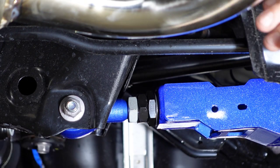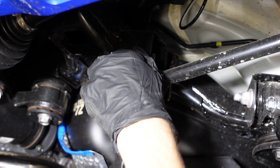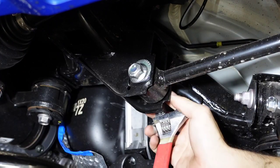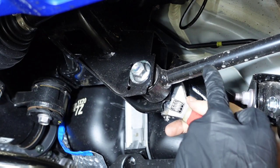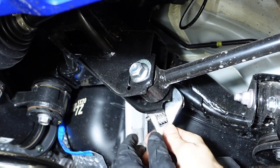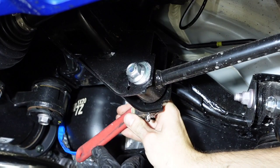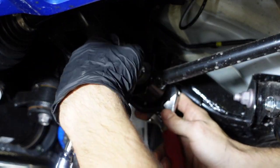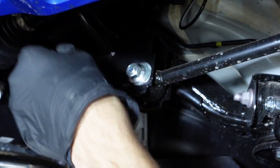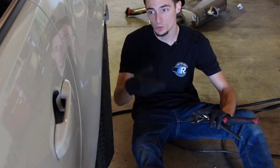So if you're going for that stance look and you want a lot of camber, you can accomplish that just by pushing the rod out further with these adjustments. If you're feeling adventurous and want to try the alignment yourself, you can break this loose — this is a 19 millimeter — this is going to be your toe adjustment. If we go this direction it's going to push your toe out further, so we're going to go the opposite direction and bring it forward to pull it in. I'm going to leave the camera on the tire so you can see what's happening as I make the adjustment.